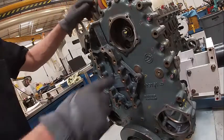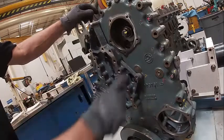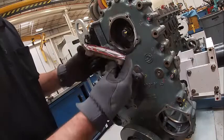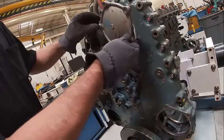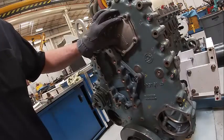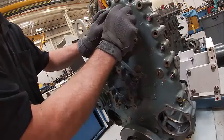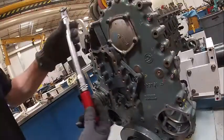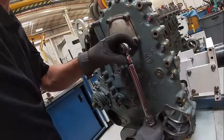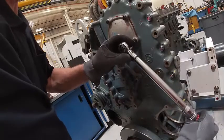Now we can go ahead and put our cover on. We're going to put our camshaft cover on — I put a thin bead of gasket eliminator on it. That's 22 foot-pounds. I just barely hit those with an impact gun and they're tight, so you've got to be usually more worried about over-torquing than under.